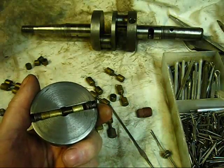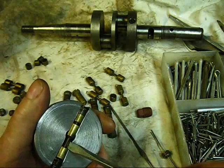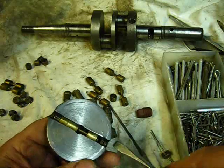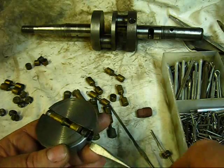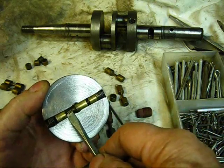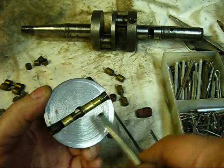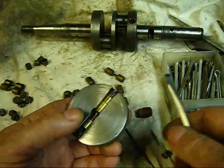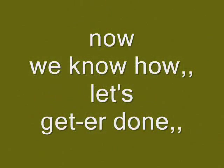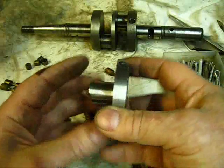This regulates the amount of air-fuel intake. All of this in conjunction is the reason you need to be using 30-weight non-detergent, especially a mineral oil base. There's a bottom screw down here with a slot sawed in it — you crimp that together, and when you put it on it'll lock, stopping how far down it goes so it can't shut the engine off completely.